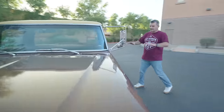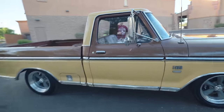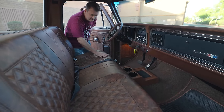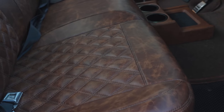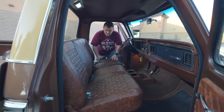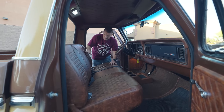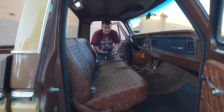If you look at the truck, it kind of has this vintage feel and we really wanted to create a nice vintage feel. We've got some really beautiful leather that we purchased from Relicate Leather - it's kind of that distressed, aged look. Now keep in mind this is an original bench seat, but we took all the springs out of here because if you hit bumps it's just like a trampoline. All the springs have been removed. We've put a piece of plywood bolted down to the bottom and to the back, then we took and foamed it. We put a little contour shape in the foam, set it all up so it's still soft and you can sit in it, but it's not going to be springy.